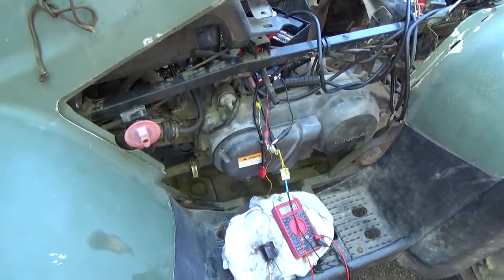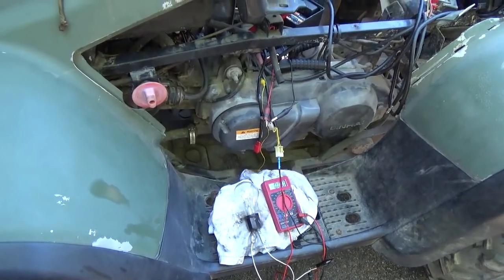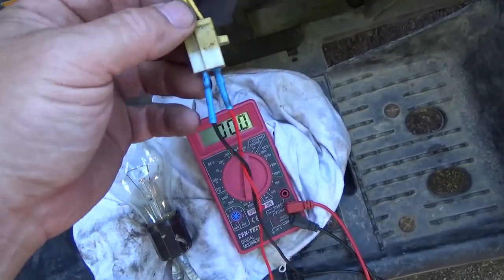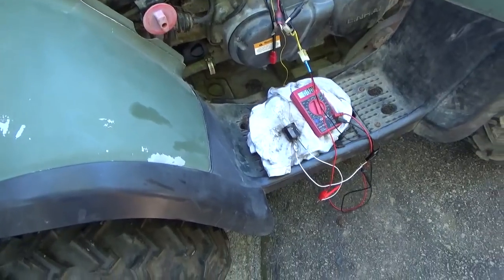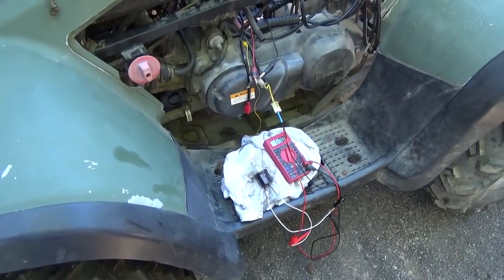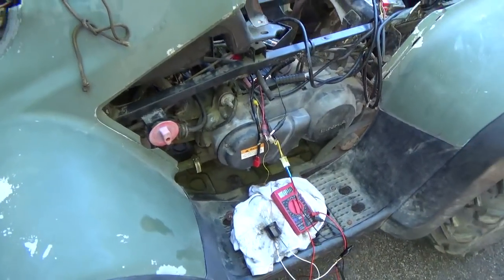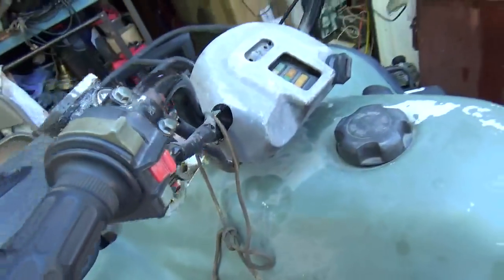The video really ends with us seeing that we had three phases and the light bulbs were all lit — the light bulb lit on each phase and we had voltage on each phase. Some of them are two-phase; this one's a three-phase. But on a two-phase you would hit the center and then these two, and typically the center would be at a ground potential. This bike has a lot of things I'm not used to — I seem to be doing a lot of reading on this thing. But once again, I know my stator's good, I know my pulse generator is good, and from here I could build an ignition system and a wiring system so that the switches work and everything else works.